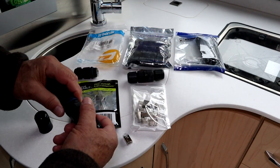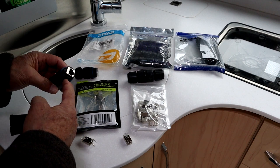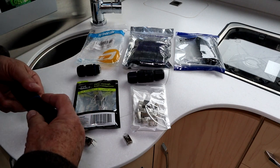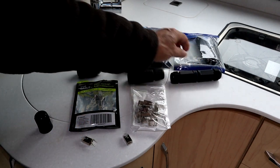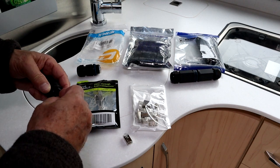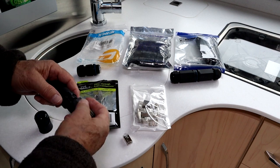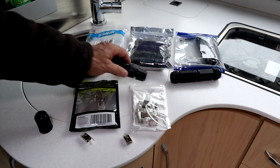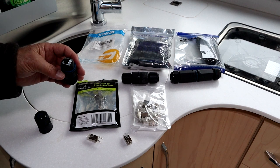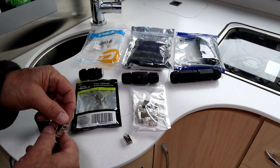When I looked at another one I bought that looks different, the inner connector piece still has the same blue gasket — they look identical and I think they're made in the same factory with just different outer covers. I had the same problem getting these to fit, but could force them in eventually. What I found in the end: when I crimped it onto the cable with the crimp connector, it started to fit without having to force it in or out.